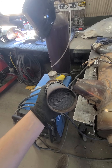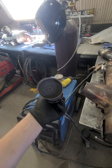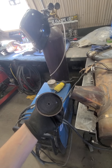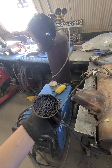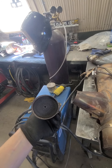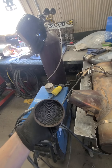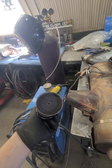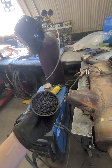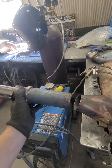The cat gets super hot - I think it's probably the major contributor to the heat in your Pioneer. You can recode it, do tune-ups, and they work, but I think so much backflow and hot air comes from the super hot catalytic converter that it contributes quite a bit more than anything else.